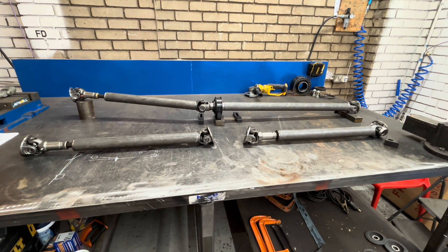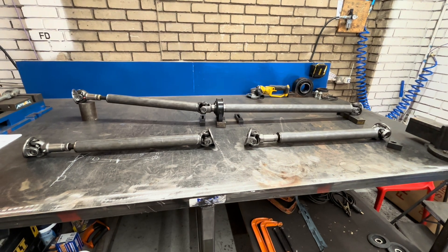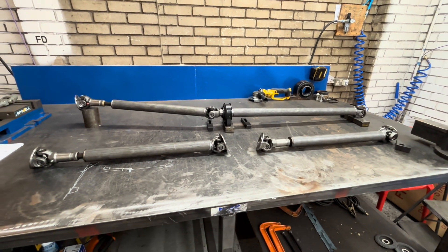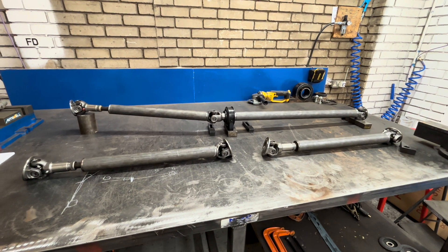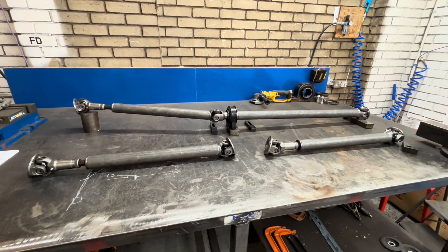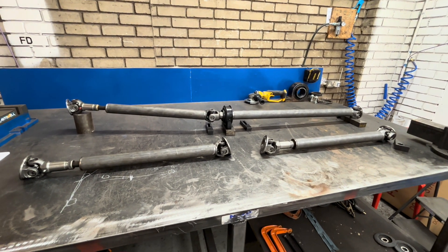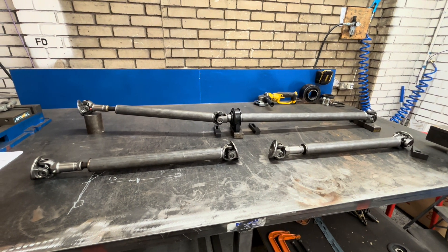That's the two configurations of prop shaft — one without a reverse box in the middle, and one with the reverse box. If you can keep the reverse box in, I think I probably would, because it means the vehicle's more maneuverable and it does solve the problem of angles and vibration. If you want to take it out because you want more speed or because the reverse box causes too much hassle, then the second option is obviously the way to go. Both of these are made in-house here at Northwest Propshafts, and we can design them to whatever specification you want, as long as the steel will allow us. More often than not we find the front flange off the gearbox is 87mm diameter, and a lot of people tend to use Ford rear axles, which is 109mm diameter, so it can all be modified to whatever dimensions you've got.